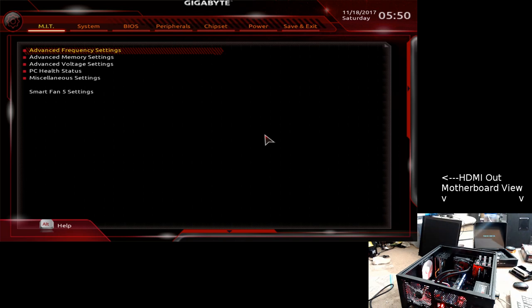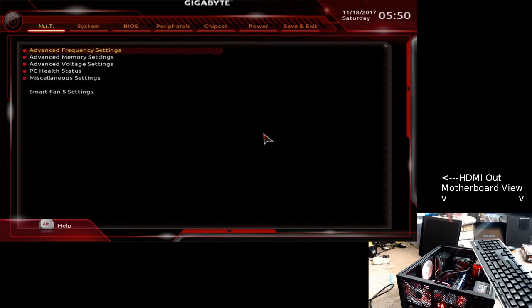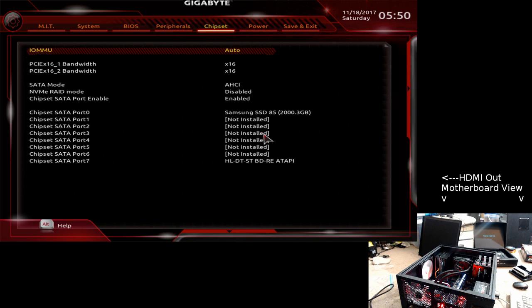Maybe somebody, like I said, this motherboard number two is acting completely different. This guy with F1, when it was on F1, I was able to plug in USB, mind you, it's a wireless USB to this mouse, into this keyboard, which works perfectly fine inside the operating system. See? And it's plugged into the case USB 2 header on the case, and it's now working now that I've reflashed it up to F3G. This number two board acting weird.